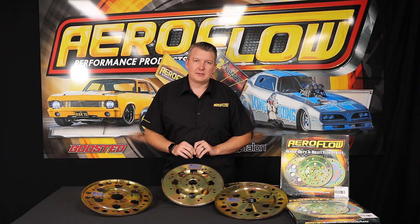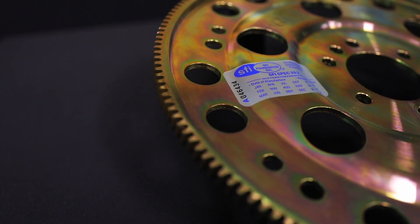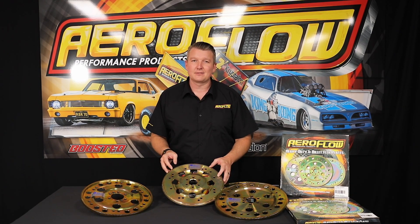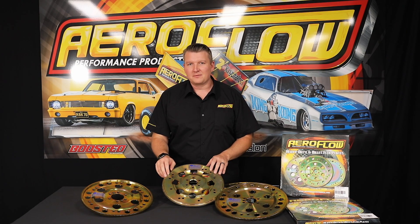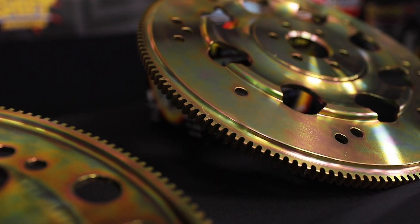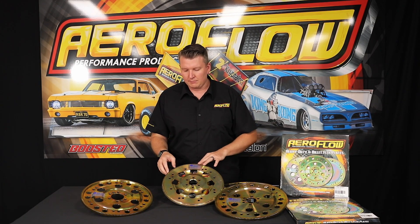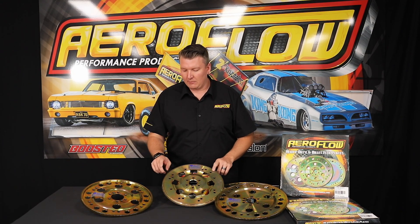A couple of other key features to touch on: as you can see by the label, these are SFI rated. For drag racing guys, this is an SFI rated component — there's no non-SFI option with the billet flex plates; they all come SFI rated. You might also be thinking that a two-piece design is good because if a misaligned starter wears out the ring gear teeth or they get damaged somehow, you can replace it. That won't be an issue here because the material is much higher quality and much stronger. The outer section is also heat treated so those teeth won't wear with regular use from the appropriate starter motor. Obviously if there's a misalignment or something's not right, you may still get some wear, but they are heat treated and very high quality 4340 steel.